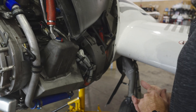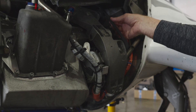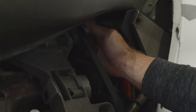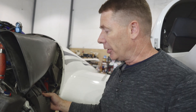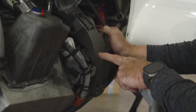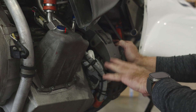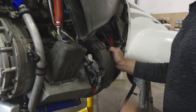In the back we have a 28-volt alternator, one per side, driven by a serpentine belt. That same serpentine belt also drives the engine coolant pump. If we lose the belt, we'd have both an overheating engine and a non-charging alternator — two issues from one broken belt. The alternator outputs 60 amps and has a temperature-sensing control diode. When the charging system reaches a certain temperature, it shuts off the alternator output to prevent damage to the electrical system, then kicks back on once it cools.